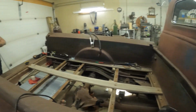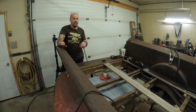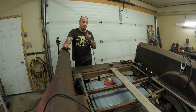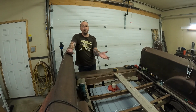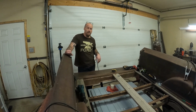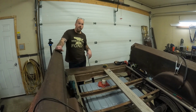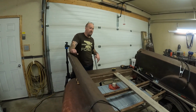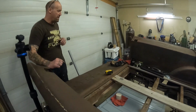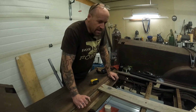I don't know. This tank here, I haven't been able to fill it up. I get about halfway. The way it is right now, the vent tube is plugged, I believe. So when it's warm outside, the fuel comes out of the venting cap. It eats up asphalt. It's a mess, and it's adding smell to your cab, too. We don't want my granddaughter sniffing that up. I want to take her for drives. I don't want to poison her.